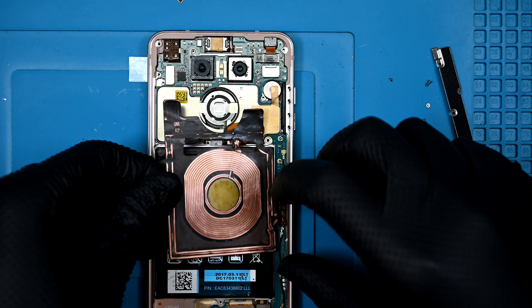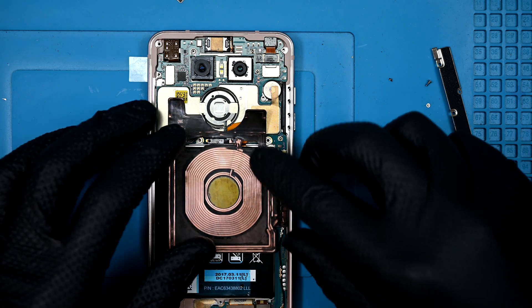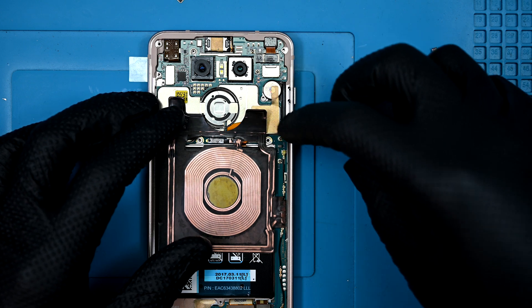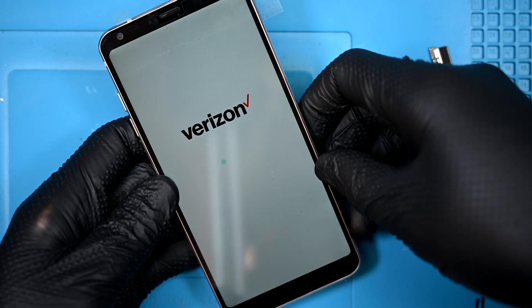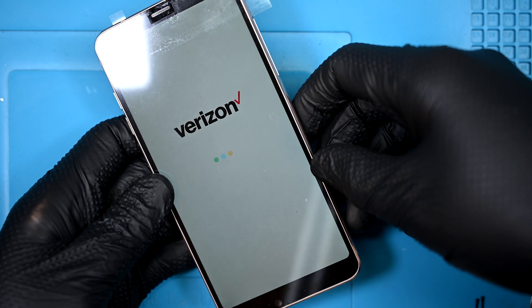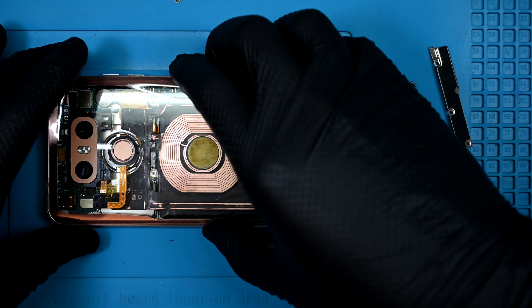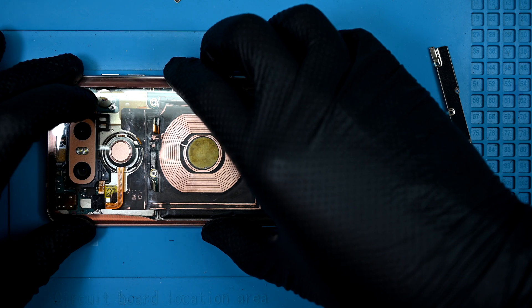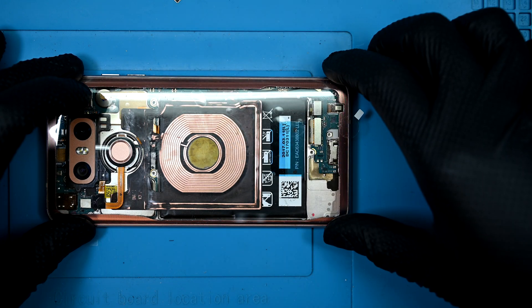The battery needs to be adhered down to the new frame with some double-sided TESA tape — it doesn't need to be anything crazy, just enough to hold it. I'll then get the finely polished wireless coil lined up. Without the plastic bracket to hold it in place it won't really work, but again, I'm going for design over function. I'll do a quick functionality check to make sure it still powers on. Finally, the clean and transparent back glass can be pressed into place using the pre-installed adhesive under the golden paint that was left on the edges.